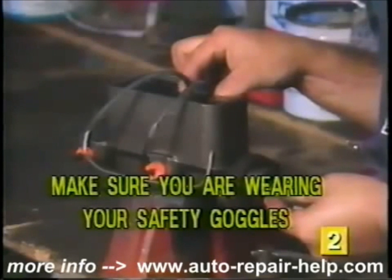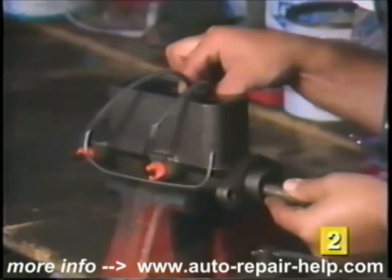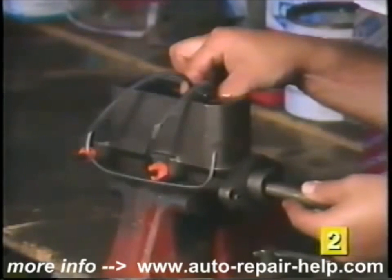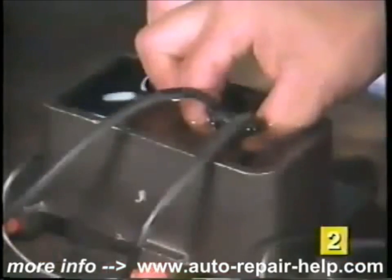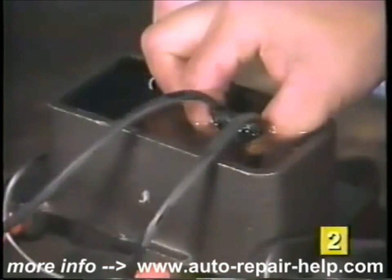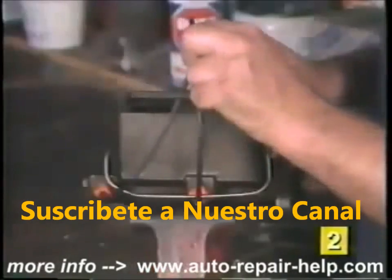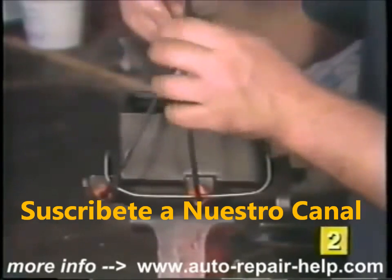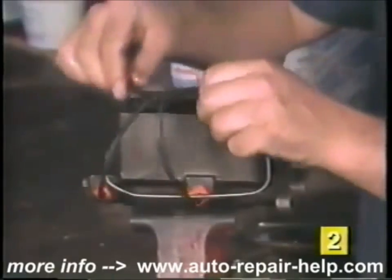When the piston has traveled its full stroke, squeeze both hoses closed against the dividing wall of the reservoir and allow the piston to return to its normal position. Make sure the hoses stay submerged in the brake fluid. Repeat this procedure until the fluid coming out of the ends of the tubing is completely free from any air bubbles. Remove the ends of the tubing from the fluid and tie the rubber tubing in a knot to prevent fluid spillage. Do not remove the tubing or fittings yet.